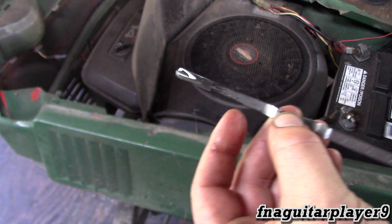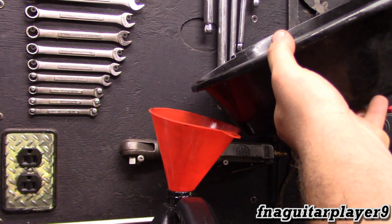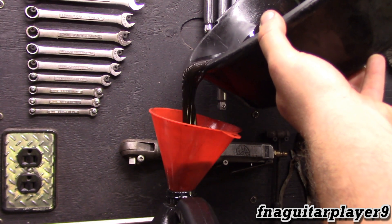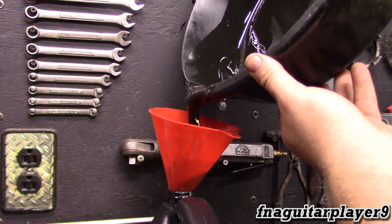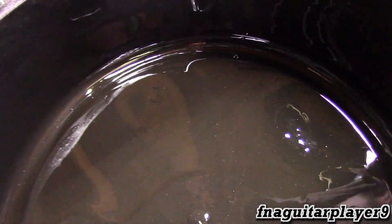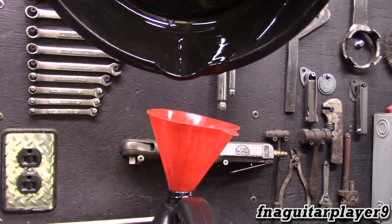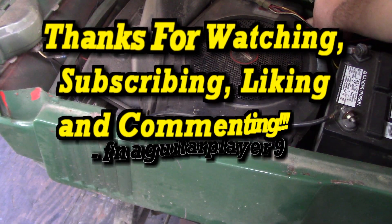It's still right on full after running it. As far as the old oil goes, just dump it in an old oil container and take it to a place that recycles it — most auto parts stores do it for free. If your pan is clean before you drain it, it's a good time to inspect for pieces of metal. You can actually see a few little tiny pieces here and there, and that's normal. If your engine has an oil filter, it's going to catch all of that.